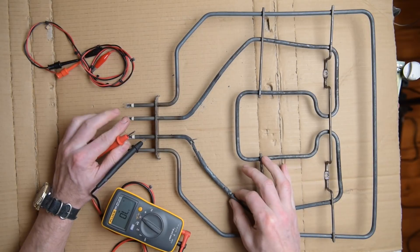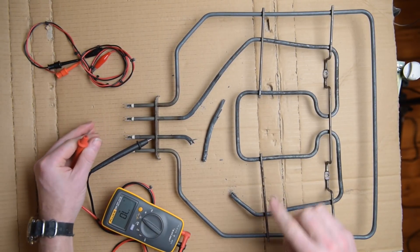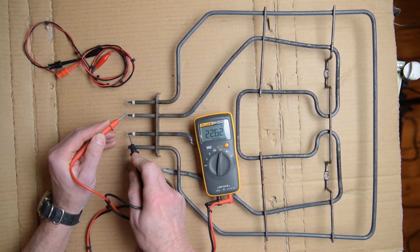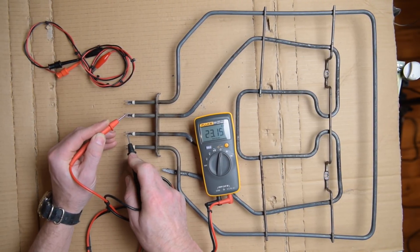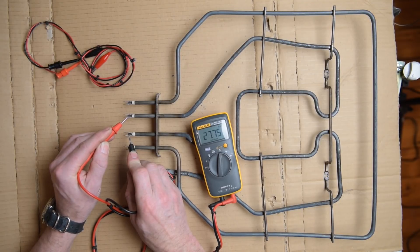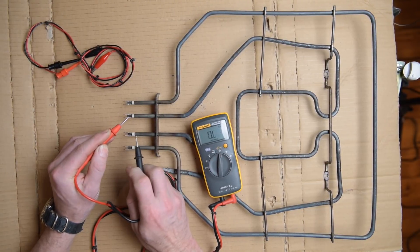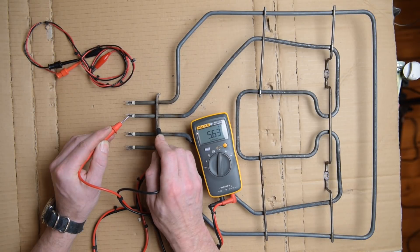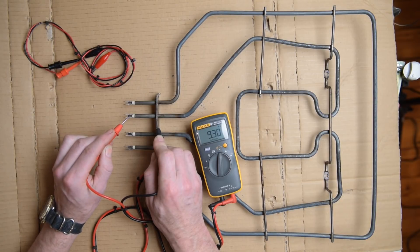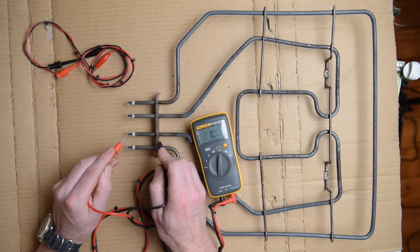You can clearly see here there's a cut in it. Put it back to resistance — got 39. We check here now; that to me is bizarre. If you were completely blindfolded of this and you checked that, some may say 'oh I think that might be okay' — from 34 to 24, 39 or whatever it was to 24. But if that was a bit higher, maybe even more so. Straightaway there you go — you can see from the earth point to there, you've still got a resistance.